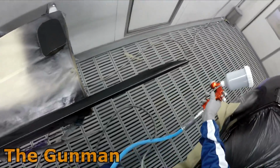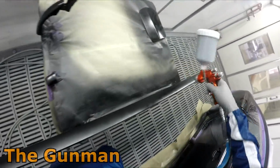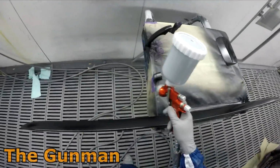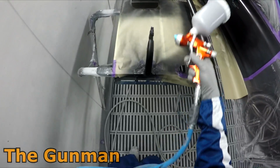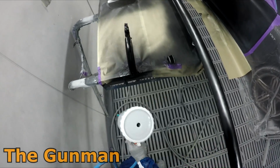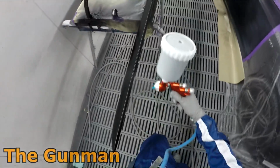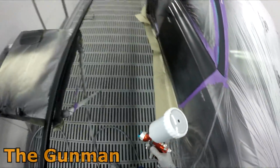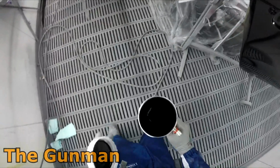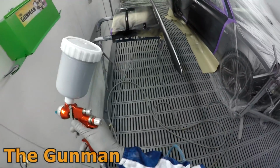I only mixed up like 200 mils of colour for this job, and as it turns out, you'll see in a minute, I was checking how much I had when I finished the job, and I just scraped through. So yeah, 200 mils is enough for this job. I would probably recommend, if it was my apprentice doing this car, I'd say just go 250 up to even possibly 300 mils. But I know that this colour covers really well, and I can save a little bit of money for the boss by using minimal materials.